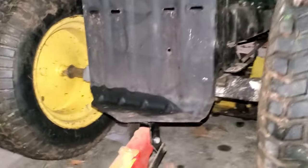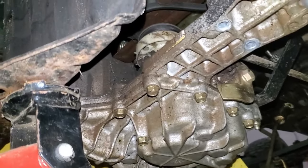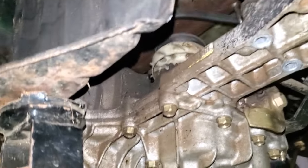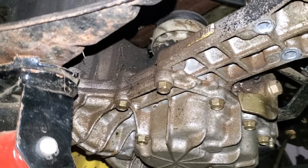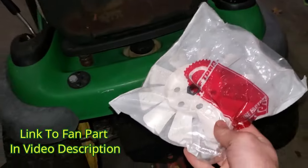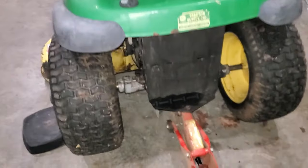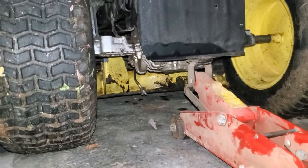If you look under the rear, there's your transmission and you'll see there's a fan right there in white. If you look at mine, it is completely broken and doing nothing to help cool this transmission. The drive belt goes all the way to the back and turns that fan blade. So what's happening is after a while, the hydrostatic transmission is overheating because it doesn't have a fan to cool it off. Here's a replacement.